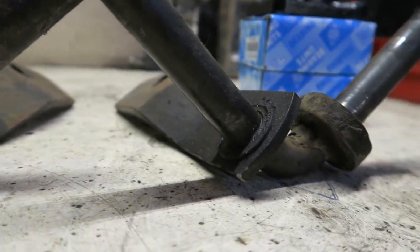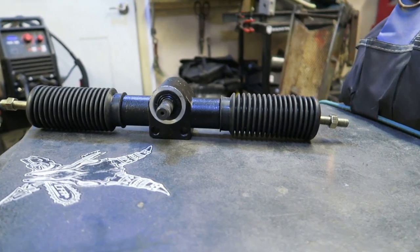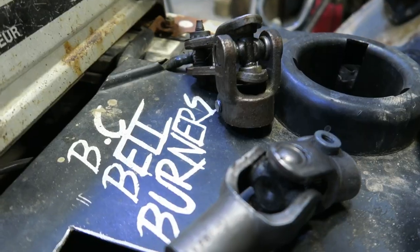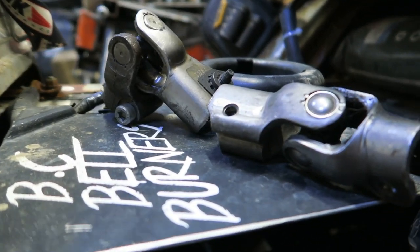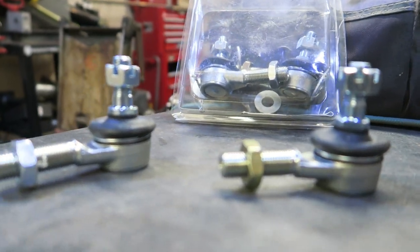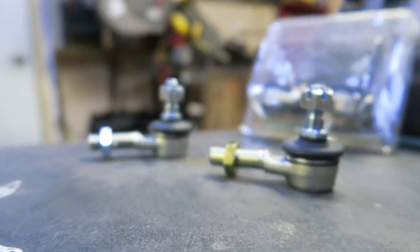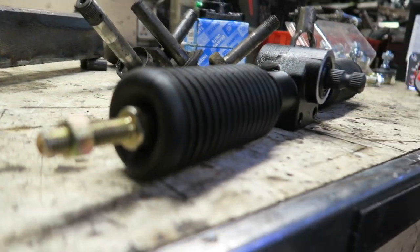We're using the factory SS16 spindles because they are some of the nicest spindles you can get — we'll show you why later in the series. We've got a rack and pinion style steering setup out of a go-kart or golf cart setup, and we used it and it worked great. We're also upgrading the whole steering system to universal rag joints, so there will be no separate gearing — we'll rely on the gearing in the rack and pinion. The rack and pinion also needs new tie rods, and we got some really nice M10 tie rods, off of a Honda 300X or something like that.